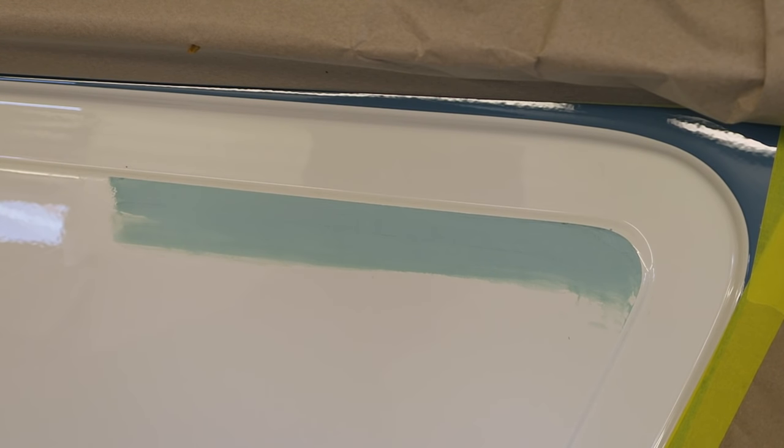So as I've said in many of my other videos, there's a twofold reason for using a coarse paper to start with. And that is obviously to rub it down quicker. And it is because a coarser paper will cut the material that you are trying to sand down, and it'll cut it in a straighter line than finer materials will. So you'll cut it first with a coarser material, and then you'll finish it off at the end with smoother materials just to take out those harsh scratches. If you start right from the beginning with something very, very smooth, not only will it take you a long, long time, it also won't be as flat as if you'd used something coarse that cuts it cleanly and squarely.